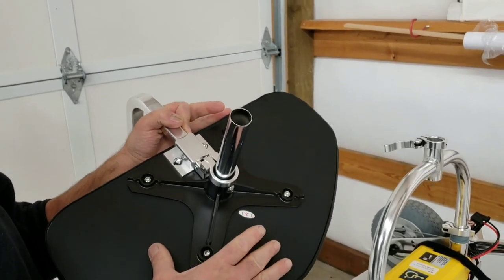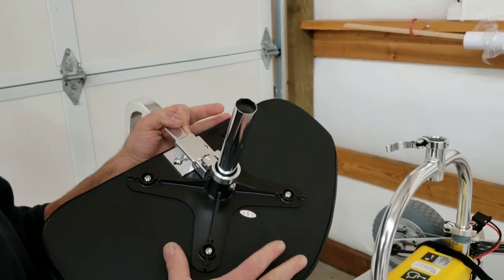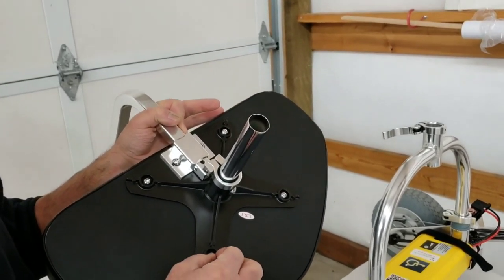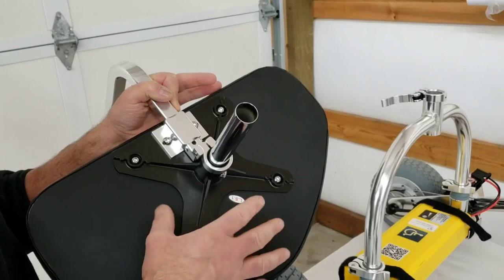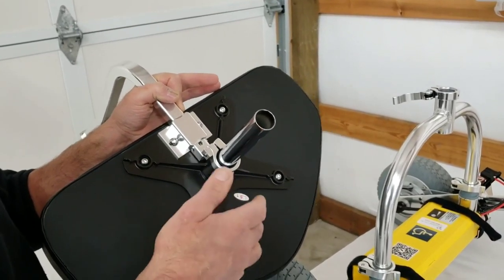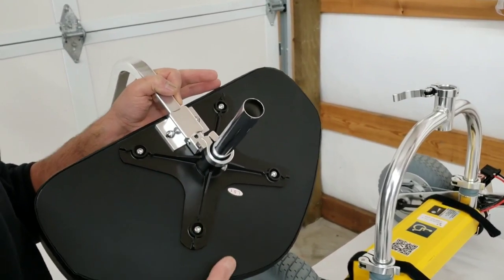The seat itself is made of a plywood plate with threaded inserts in it. Over time, these screws will compress the plywood, so they will become a little bit loose. Check them from time to time — they can actually fall out if they go unchecked for a longer period.